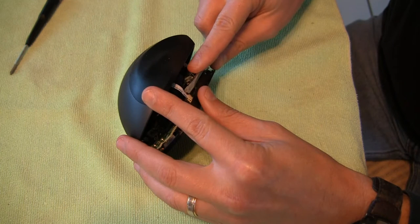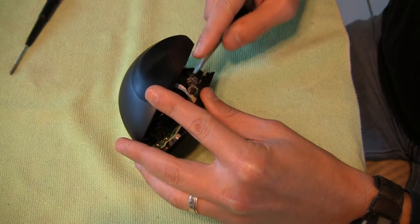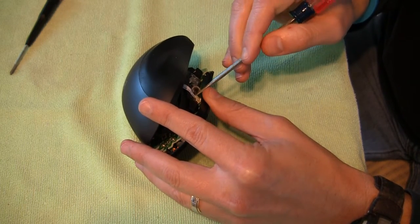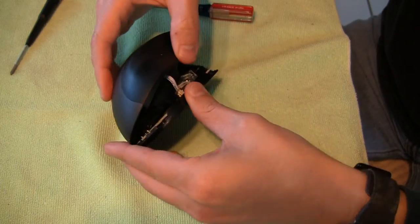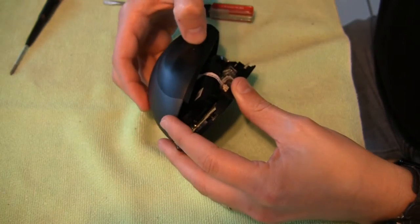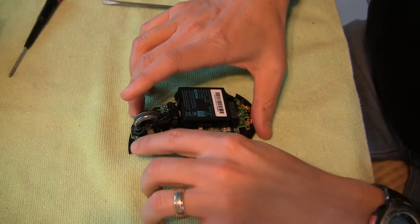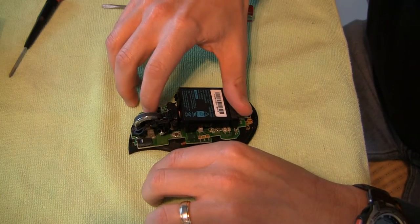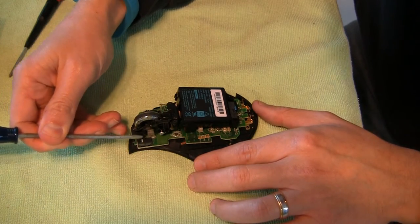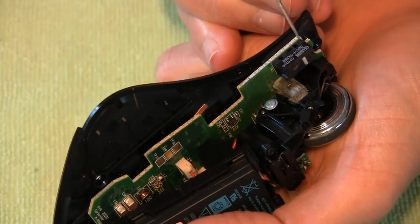In the base of the mouse, there's a little connector, basically, and there are little arms that you need to reposition that will take the pressure off of the cable, which you can hopefully see there. That will allow the white cable to easily remove from the connector. Now you can set that part aside. And here I'm just testing out the buttons. It would function, but just wouldn't click up, so you couldn't do a quick double click.